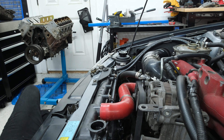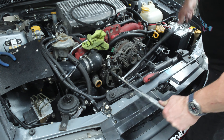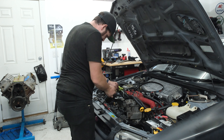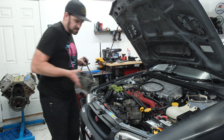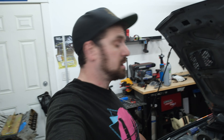The last big item to do on the list was the power steering pump. You have to remove the upper radiator hose and the power steering lines themselves. I kind of screwed up because I thought I could just take the front bolts off and remove the pump itself, but you actually have to take the entire accessory bracket off the left side from the alternator. Once I figured that out, everything was a cinch — pulley came off, everything else came out. The bolts were all lubed up from the ATF leaking out of the power steering pump previously, so they weren't tight or hard to get out. The whole housing came out, we got the new one in. Got coolant in the radiator and the expansion tank. Kiddo's sleeping so I'm going to call it a night.